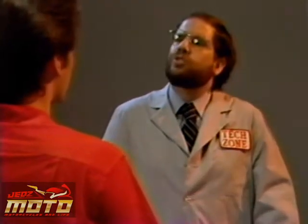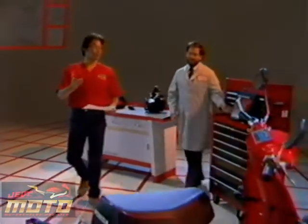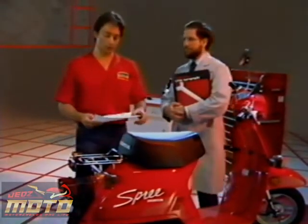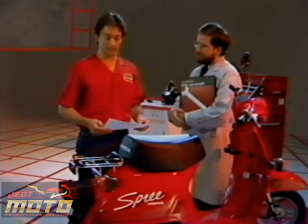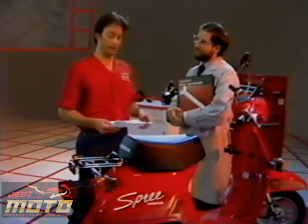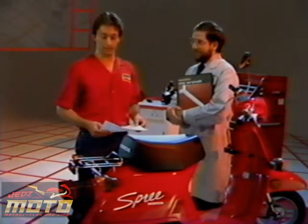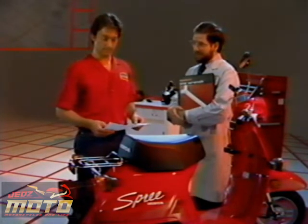Now, don't you have a scooter that needs repair? Yeah. Well, according to the RO, the scooter won't go over 20 miles per hour, and the customer mistakenly put 30-weight motor oil in the oil tank, and on top of that, they haven't had it serviced in over 6,000 miles. So first of all, I figured I'd replace the 30-weight motor oil with Honda two-stroke oil. Maybe that'll help. That's a good start. Honda two-stroke oil is specially formulated to minimize carbon deposits.